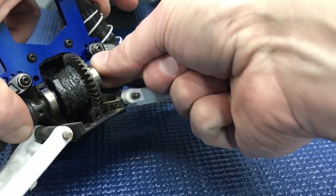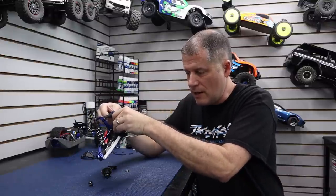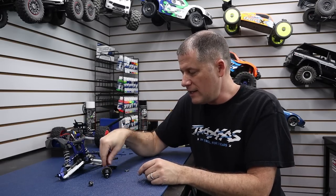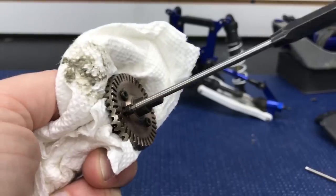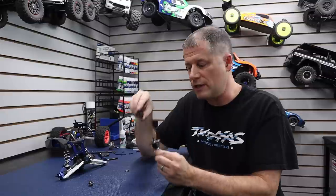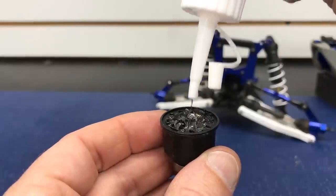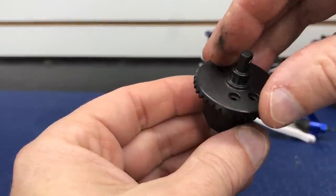I've got the rear differential out of the rear clip. First up, I'm going to pop out the bevel pinion — it's just pressed into the gear in the back, it just kind of falls right out. Now it's ready for the new spiral cut gear. When you take everything apart, make sure you clean any dirt out so you don't get any dirt into the new gears. Now I can turn my attention to the differential. It's just four screws that hold the ring gear onto the differential cup. Once I do that, I'll pop this gear off, slide out the output gear shaft, swap out the O-ring, place it into the new gear, and put everything back together. Now would also be a good time to clear out the diff oil if it's been well used and replace it with new oil. I have some Traxxas 30,000 weight oil to put in if I lose any oil during the swap.